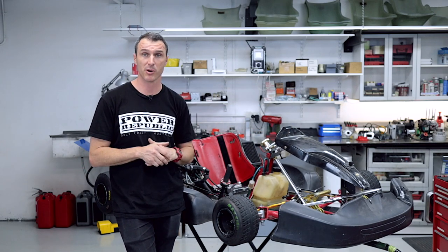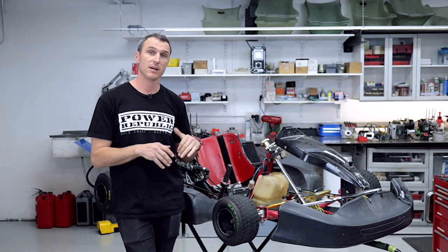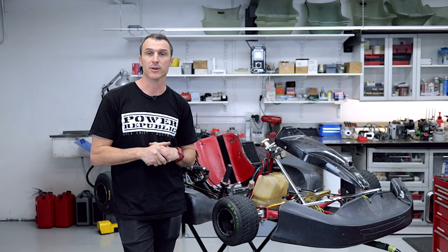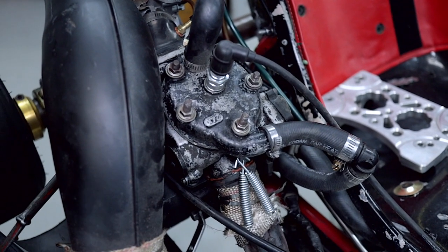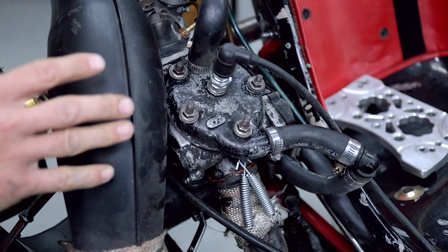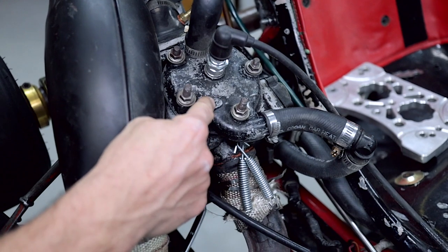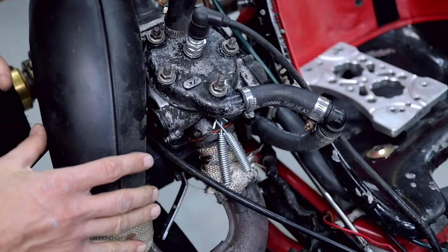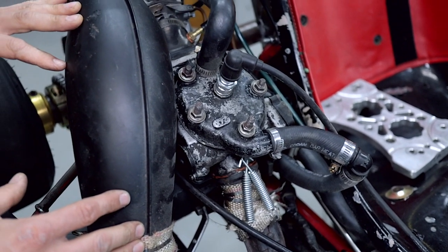It has a 125 dirt bike engine on it and it has a few issues which we're going to touch on. So as you can see, we've got a 125 dirt bike engine here — this is a Yamaha. And being a dirt bike engine, we have the exhaust coming out the front and the carburetor out the back, and that gives us our exhaust pipe out the side here. On a go-kart engine, generally we have the exhaust coming out the back of the engine, and that's good for logistics so that we keep the hot exhaust away from the driver and we can get the cold side of the engine with the carburetor at the front.